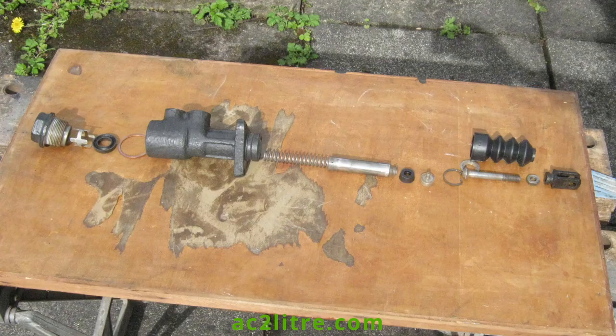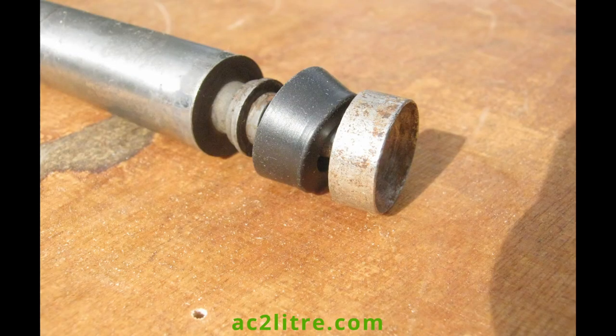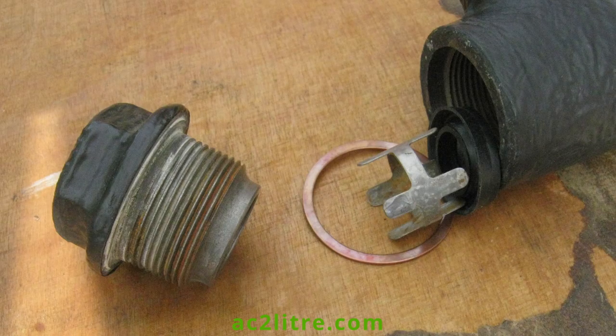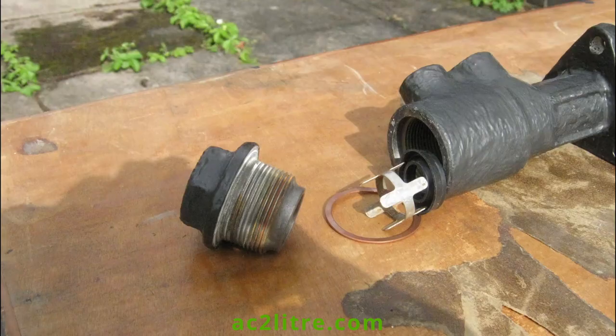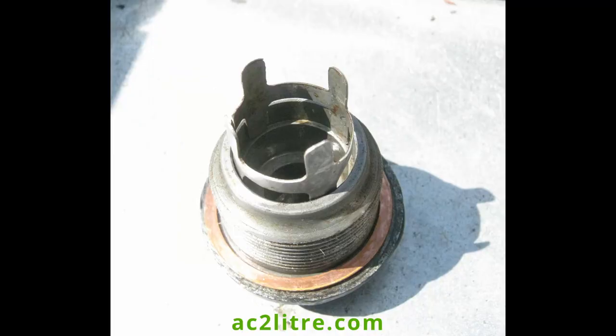The cylinder and piston should be thoroughly cleaned and degreased. The full repair kit includes a new spring as well as all the rubber parts and washers. I decided to anneal the copper washers by heating until turning red to soften them. You need to get the bits in the right order and the right way round. One detail that caught me out was this soft aluminium cage. When you insert it into the end cap, it needs to sit on a narrow ledge within the cap. If it slips off, you can't get the air out of the system when assembled.